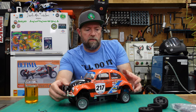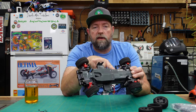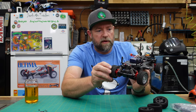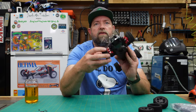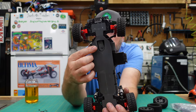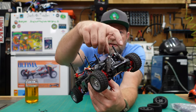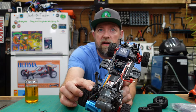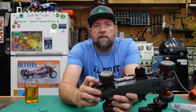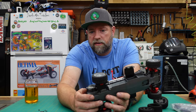It is kind of a weird chassis when you consider RC car chassis. It's a modular chassis in that it's built up with these kind of monorail blocks that you can adjust the length of the wheelbase. It's four-wheel drive. It has a nice decent fat prop shaft to get power from the drive motor to the front wheels. It does have quite a bit of slop in the steering — most of that slop is attributed to this really horrible servo saver, so that's the first thing I'm going to get rid of. The other thing is you don't have any camber adjustment on the front wheels because you have these rigid upper links. The back wheels are actually tie rods, so you can adjust the camber on the back. I gotta figure out what options we have in the gearbox — it doesn't look like there's a lot of adjustability in moving this motor and possibly putting in a bigger pinion. So we need to figure out how we can play around with this gearbox to get more speed out of it.